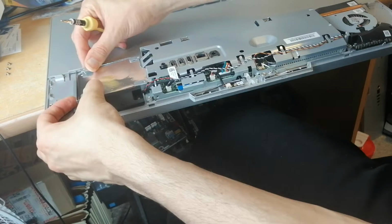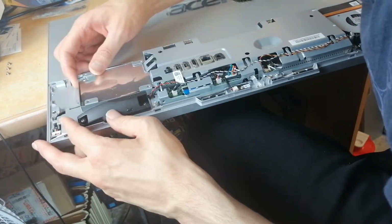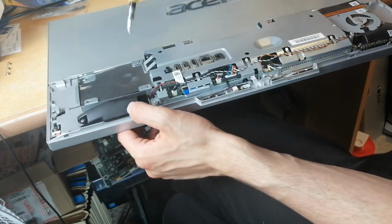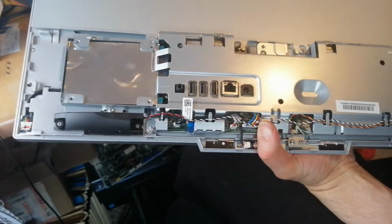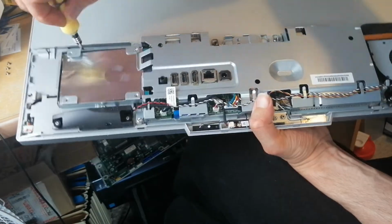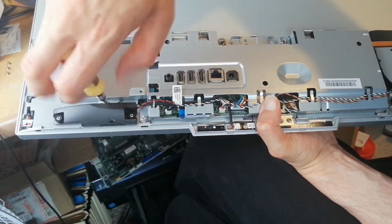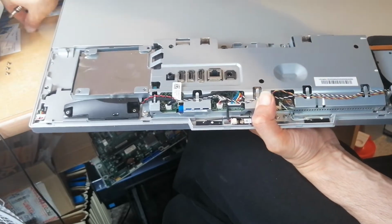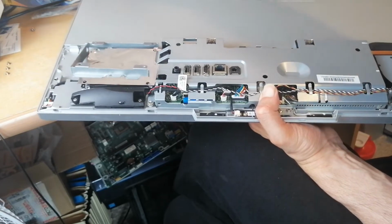To replace the drive, you want to pull this out, but it's screwed in here. So you've got two screws, one, two. These need to come out in order to pull out the brackets, the enclosure that's holding in the hard drive. So that's one screw out, second. I'm kind of rushing this because it's a Sunday, so I won't spend too much time on it. Those aside.